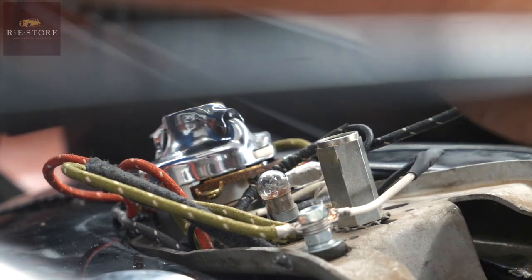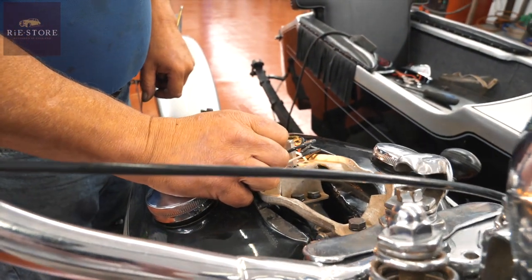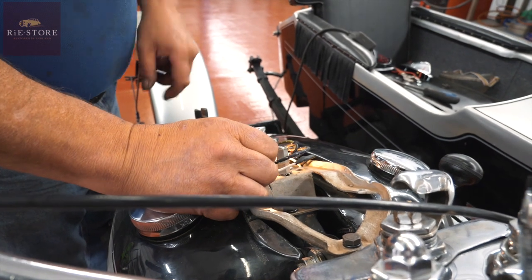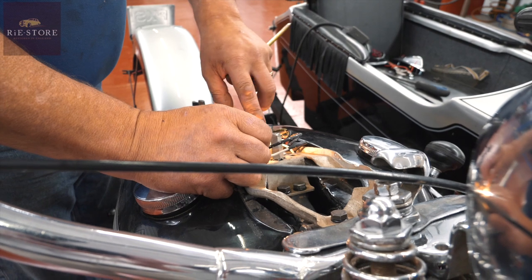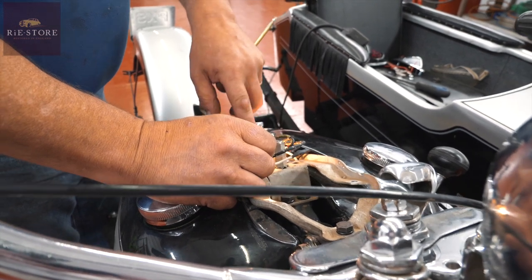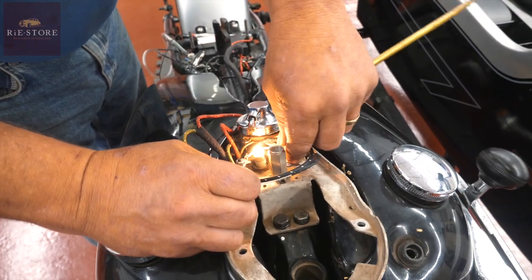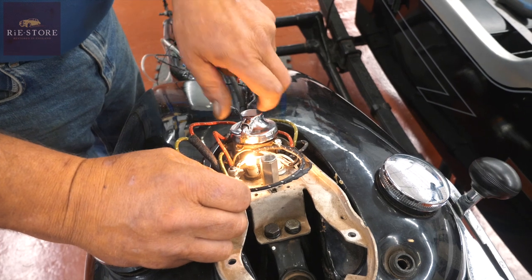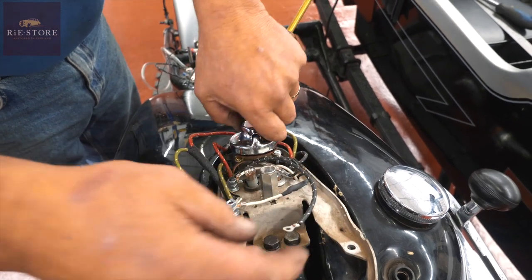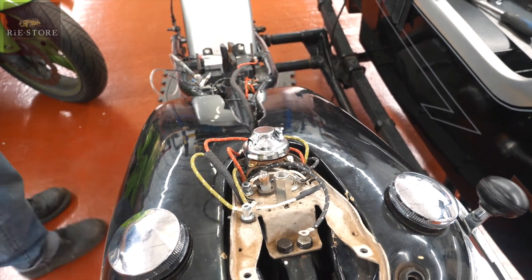Right, so now, in theory, if I put that on there, and then your dash lights work. Okay. So that is what was missing there, but I'm going to have to take this apart and change that bolt. So let's not worry about those two charge lights. One's oil, one's generator, and you can't tell until you've fired it up whether they're going to go out or not, yeah? But it means all that lot's wired up right now. So we can take that off. And let's check our lighting system.